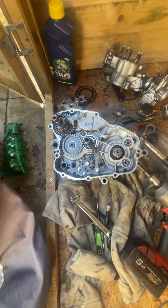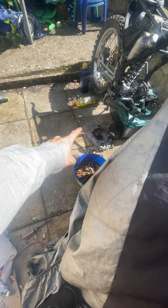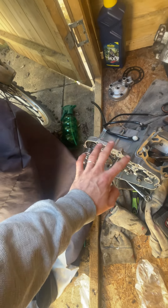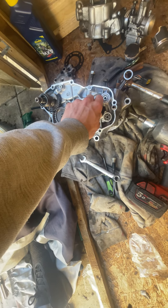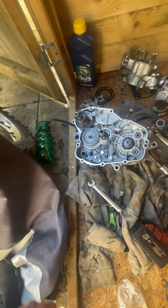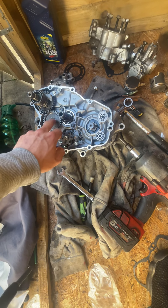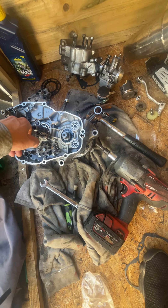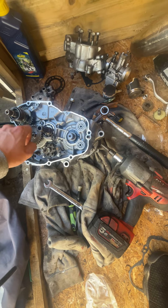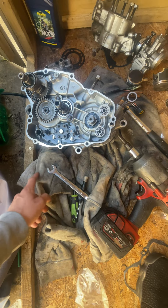To be honest I'm probably gonna get two KX100cc case halves, and I might try and repair that out of a side case, or I might just buy another one. Basically just gonna have to buy a whole new engine, but I'll just buy empty cases so it's more cost effective. Because obviously I have a free build kit and all the parts on this as well, so I basically could build two engines again. And by the time I have the first one built I might look at getting these repaired. But I've heard the KX100 bottom end with the 85 top end bored to 50.8mm or 50.5mm or something like that - anyway, that's meant to make the most power in it. That's meant to be faster than a KX105 and 112.